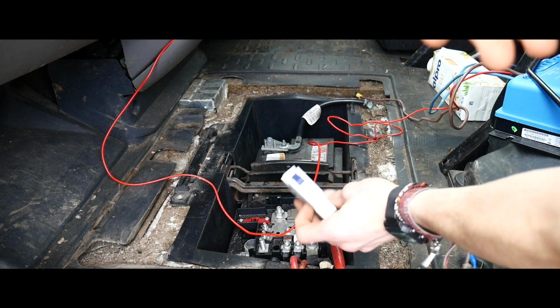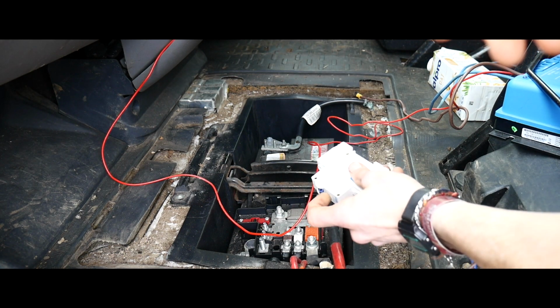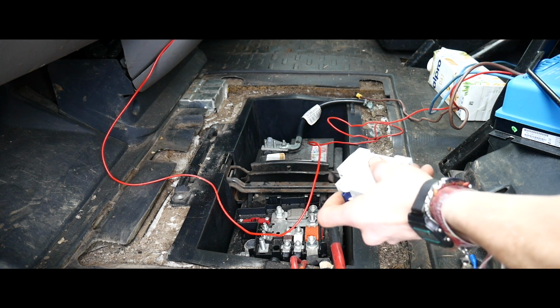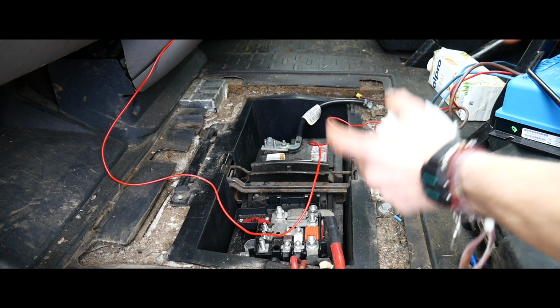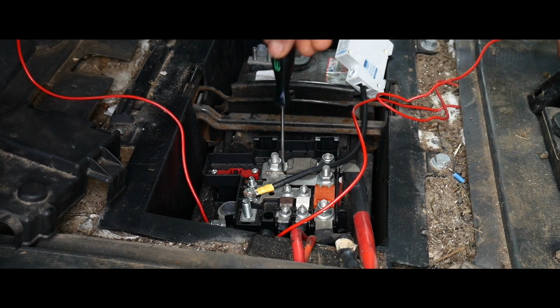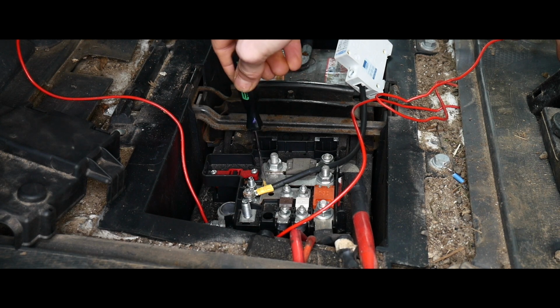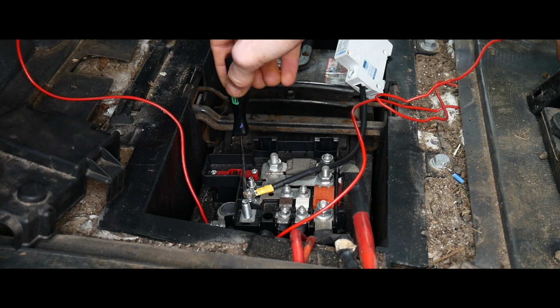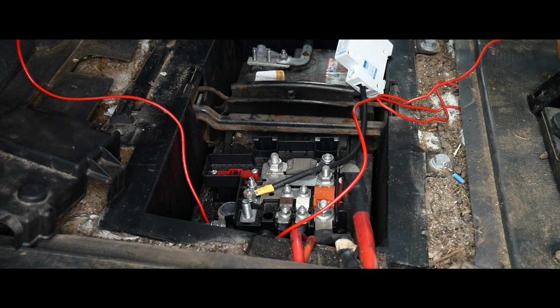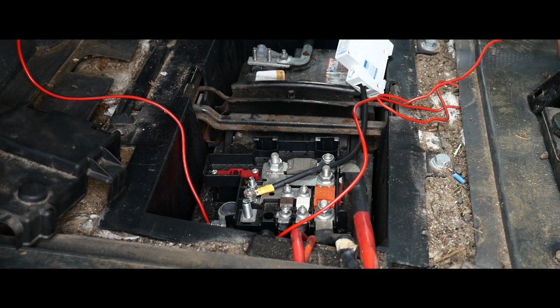So then there's going to be this 25 amp trip switch, which will always trip before the cable gets too hot. So the B2B is an 18 amp and this is 25 amp. As you can see, I've crimped a connector onto the end of the 6mm, and I've bolted it down, and then it comes through here and into the trip switch, and I've put a little bit of red tape so you know it's positive, and then I'm going to continue running that all the way back.